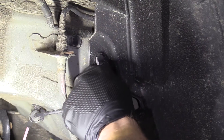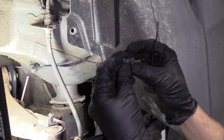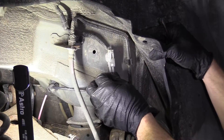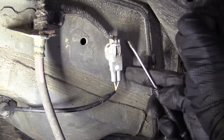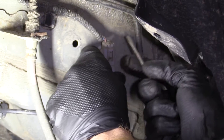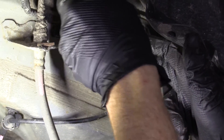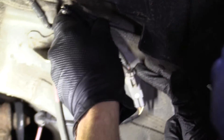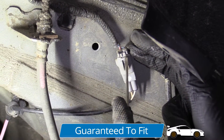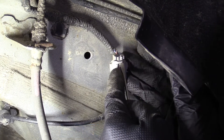I'm going to pull this little push clip because this is where my ABS wire seems to be going up into. I'm just going to pull out the center — there it is, a little push clip. Right now it's in the unlock position; once you push it in, it spreads those ears and locks it. Here's our ABS wire. Let's see if we can disconnect this. There's quite a bit of dirt up inside here, which is going to block me from pushing the locking mechanism — essentially this is the bottom part and this is the top.